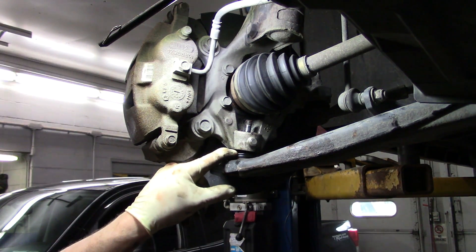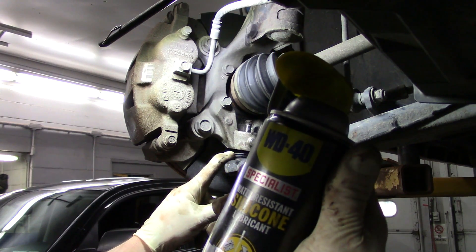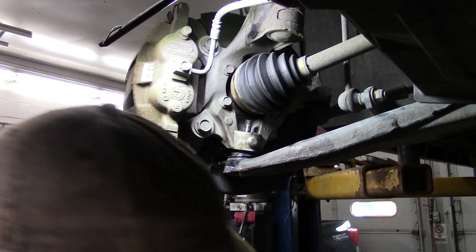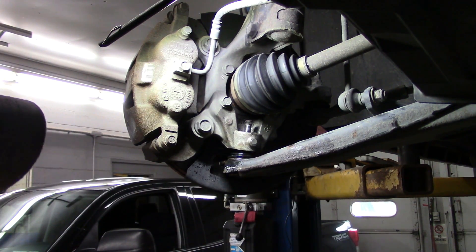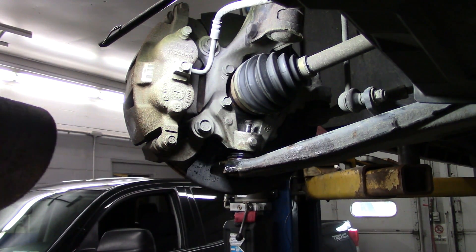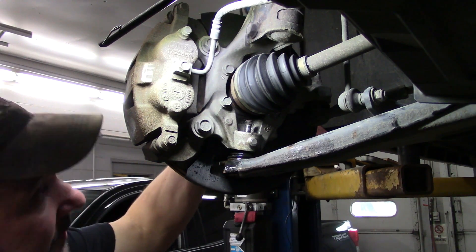What I do is take a little bit of silicone spray — some WD, not a sponsor. I give the boot a little bit of a douche because this is what you're trying to avoid. Now if you're going full gorilla changing the ball joint and shove a pickle fork in here, well, game over. So that's what we have to do.